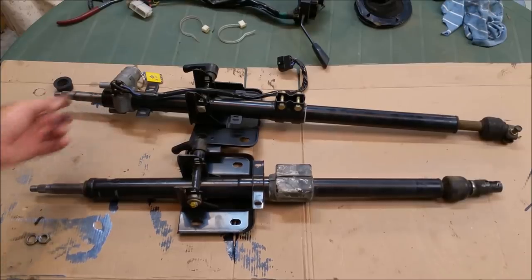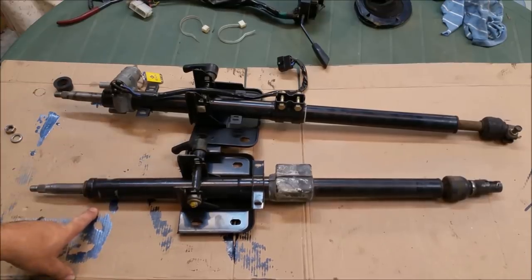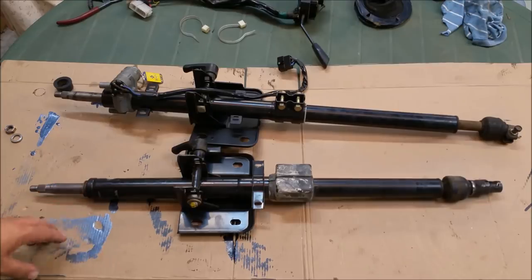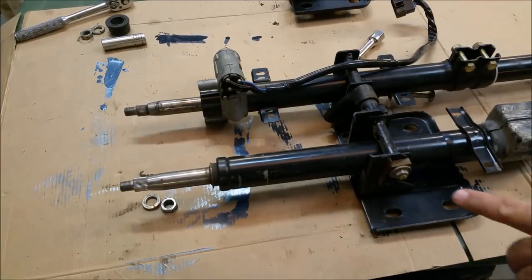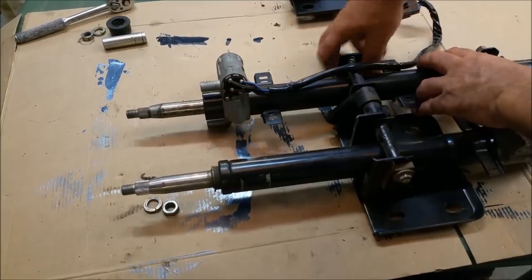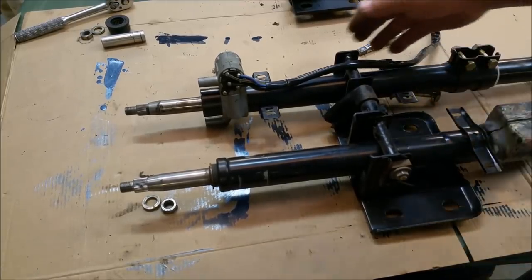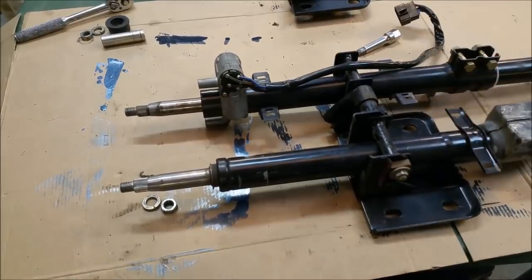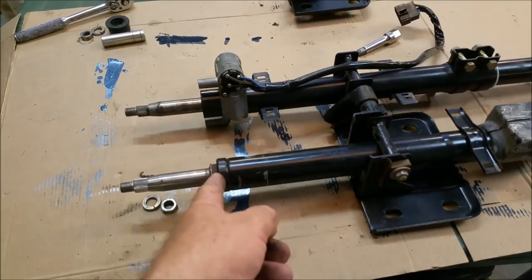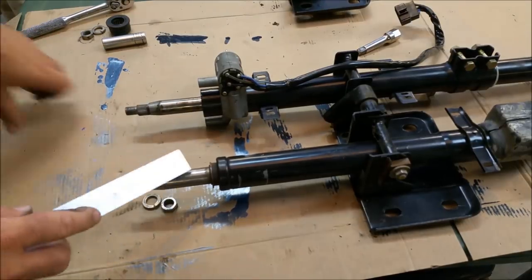The easiest way would be taking the column off and putting that on, but as we said the shroud won't fit because there is a length difference and we have to cater for that. There's a tack weld on this one; the other uses a left-hand thread and a through bolt with a left-hand thread, while this one uses a welded nut. The column is shorter at this end but the protrusion is 95mm from that collar, with most of the differences down at the steering box end.